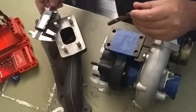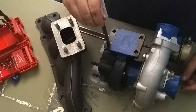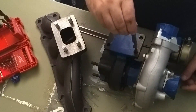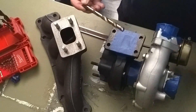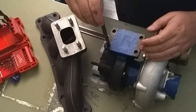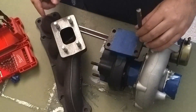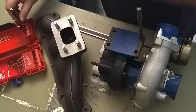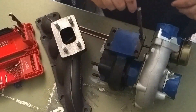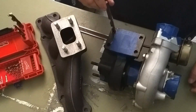What I might be able to do — first step is to safely go into this hole. The tip of the drill makes it past a little bit, but it can't get the full diameter. So what we're gonna do is drill everything out with this guy, because this seems like a pretty safe bet to start with. If I do need an additional size — my only other size in this kit is going to a half inch, and that's gonna be way too big. So I'm going to use a burr bit, and then I'll be able to measure with a caliper my diameter.